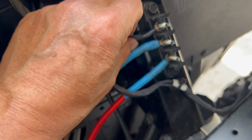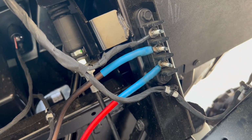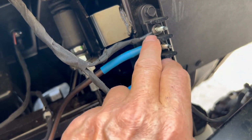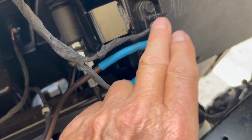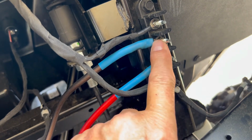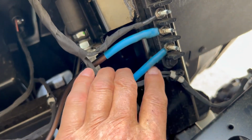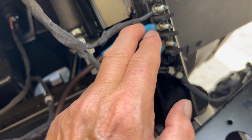So this is switch on power. Now I've seen other Polaris Busbar videos where the switch wire came already attached, and it was always attached to the top. But in my case, it was attached to the center, which according to the Polaris instructions is reserved for the ground. And then this is my constant hot, which goes directly to the battery.